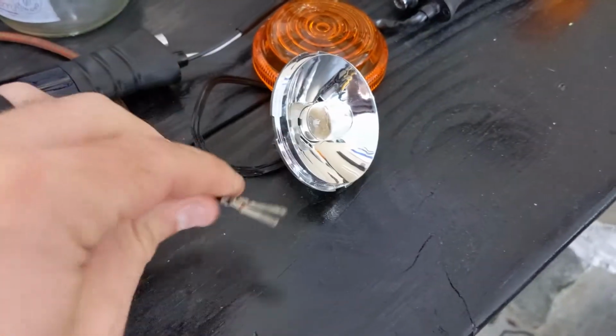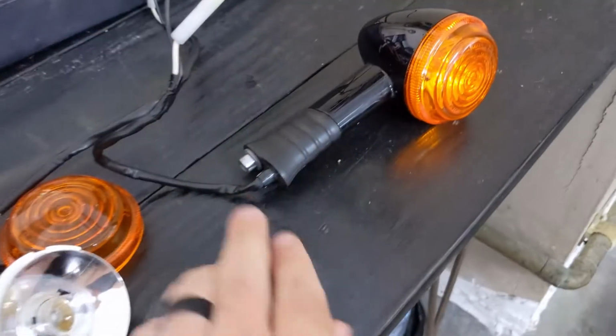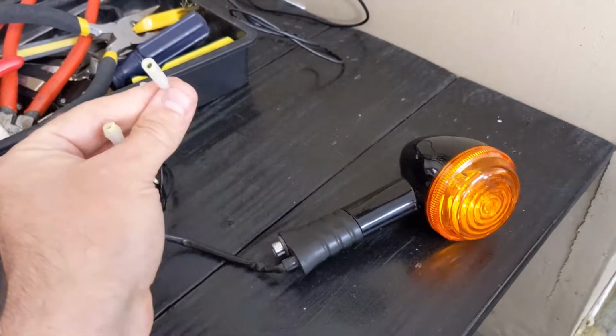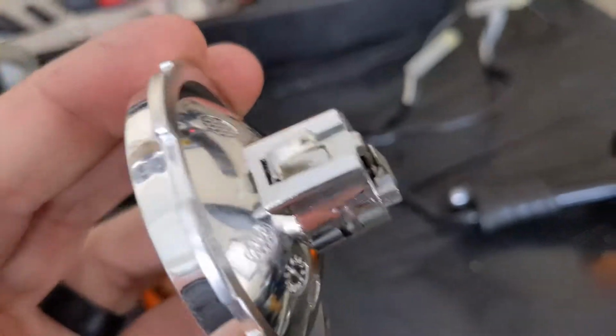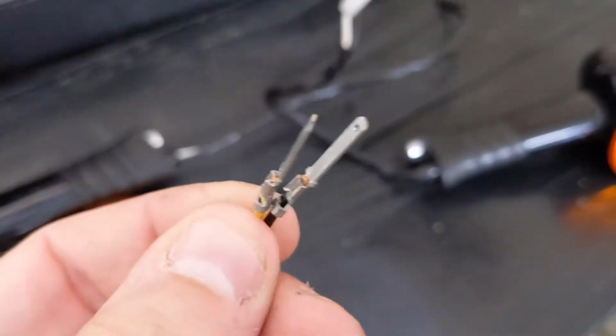These connectors here actually connect into where these wires go in and connect to the back of the bulb housing inside. So what you need to do is actually just pull out this piece of wiring from inside of these long turn signal ears, and you'll be reusing these plugs back inside there and plugging in these little guys on the other end. So I've already taken apart this one, and you can see here the back of the light is those exact same size slip tabs, that one right there, that is these on the back of these wires.